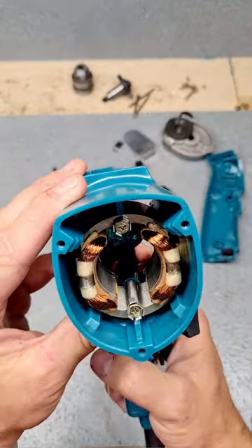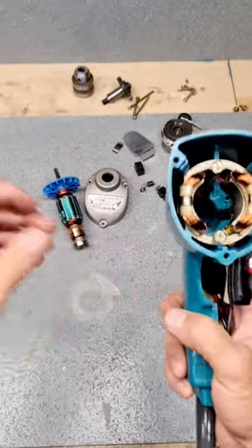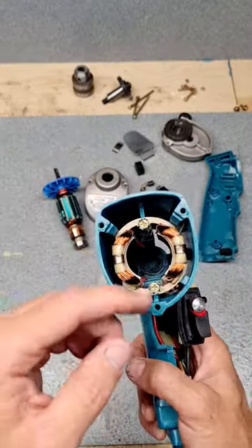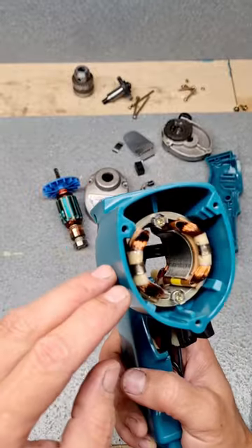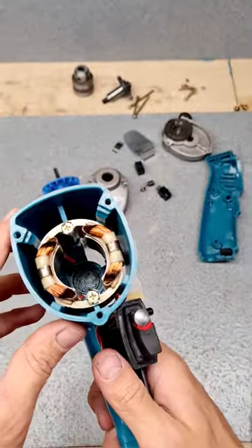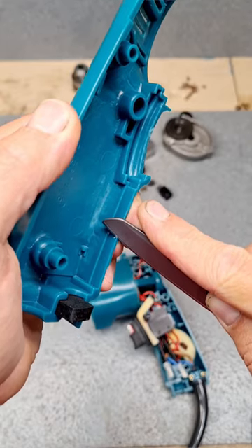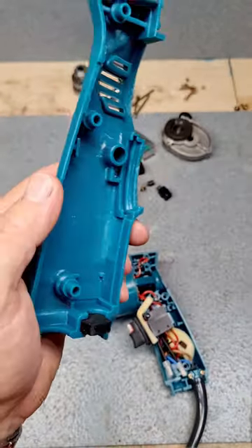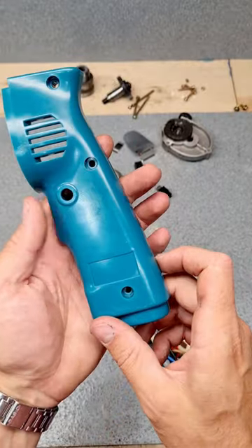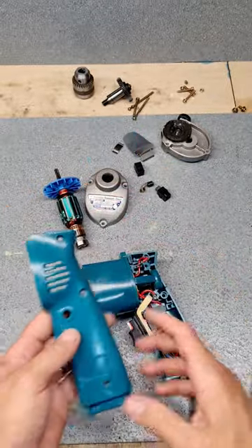Then your field, wired in as normal - standard field, same as most machines even now today. A wee air deflector as well - it just helps distribute the air better, circulate around the machine and keep the motor cool. Plastic - not the same as modern machines, probably nylon, it's definitely glass fiber reinforced. These handles were not bulletproof but they were very very hardy - probably still have a couple of these old handles in stock in the workshop.